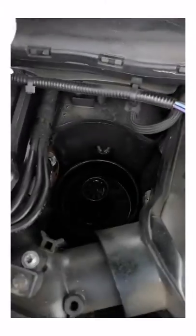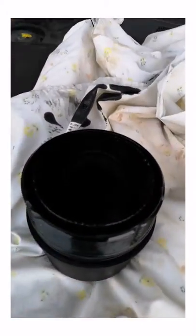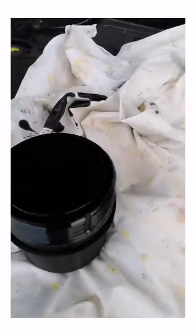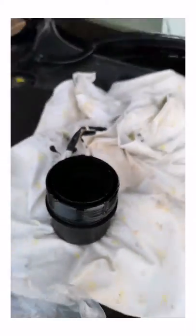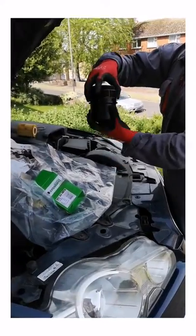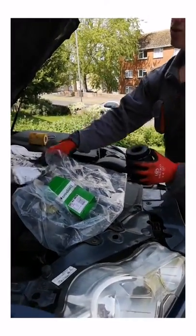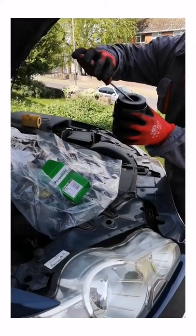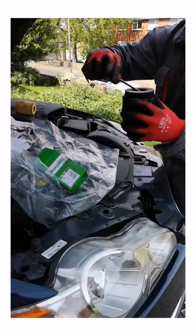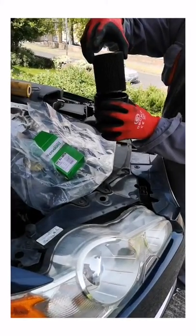There's the old filter that's come out of the casing. I'm going to put the new one in while disposing of that one correctly, and put the new o-ring around the base. It took me a while to get the old filter out of the filter casing — what I had to do was get a flat head screwdriver, put it into the side, and then wedge it out using its own rim on the inside. Once that popped — did you hear it pop? — that can come out.